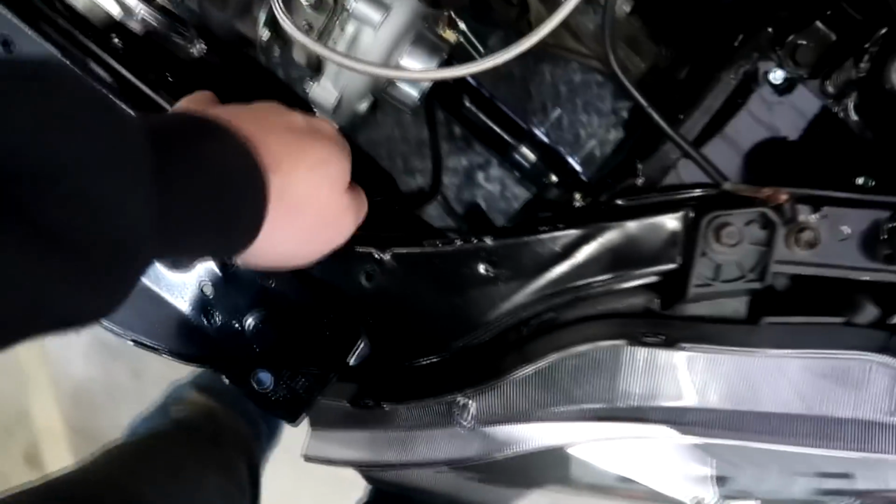All right, guys, so we just actually put a manual boost controller on this thing because it came with no boost controller, so I had a manual bleed valve sitting here that I'm hoping will work on this. We just plumbed it in, got the spring set so it's not rattling. So maybe it'll pick up like a pound or two, and we can go up a little bit at a time. Some of these manual boost controllers can get a little sketchy. One little half a turn could be 10 pounds of boost, so we've got to take it easy.